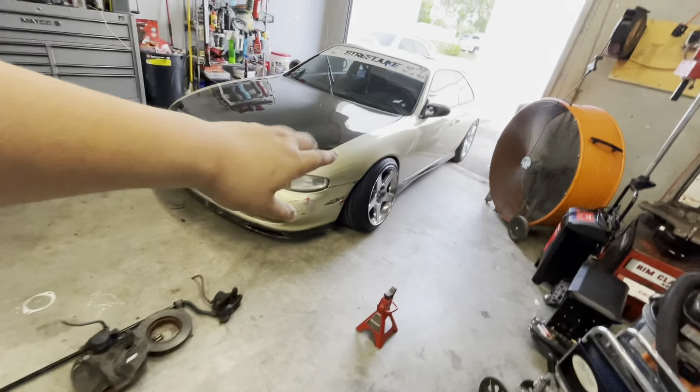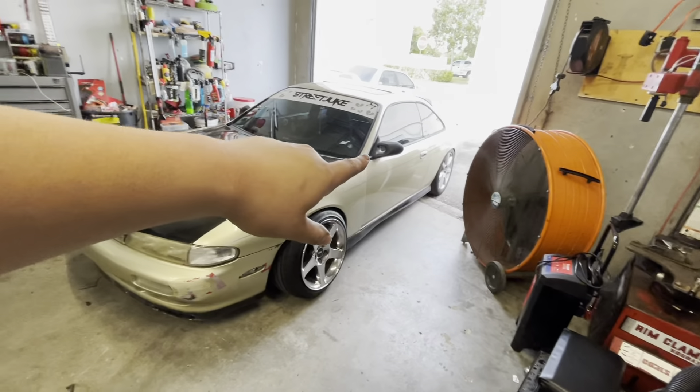During the week after that Sunday clip, I lowered the car a little more in the front and rear. Ever since then the car has been weird — lowering it threw the alignment off completely. The inner and outer tie rod actually separated from each other on the passenger side and I had to fix that back together. That's why on Tuesday I went for a real alignment and realized it's a little too short — so I ordered the rack spacers.